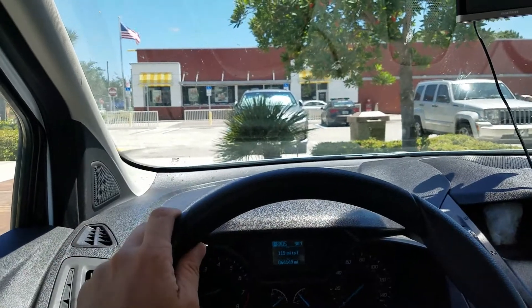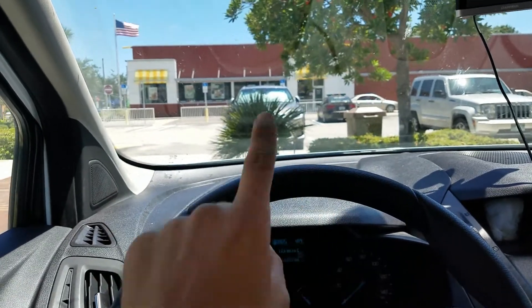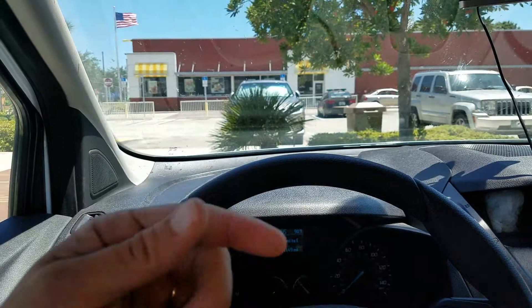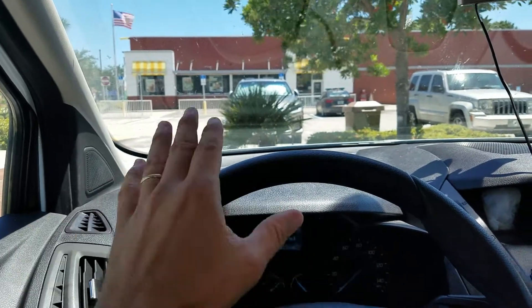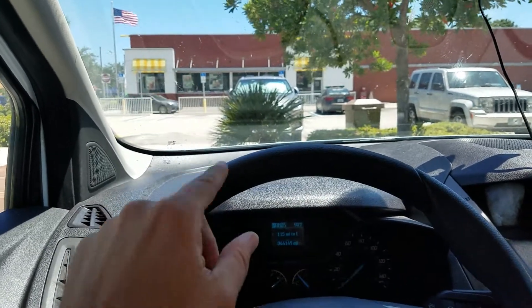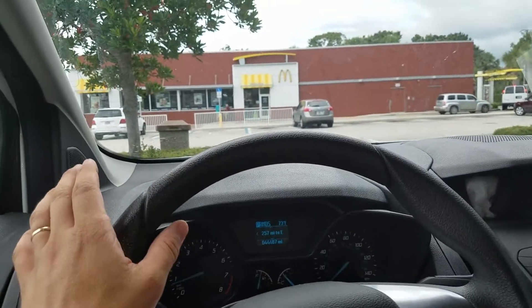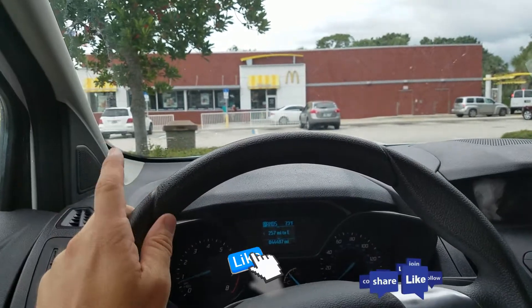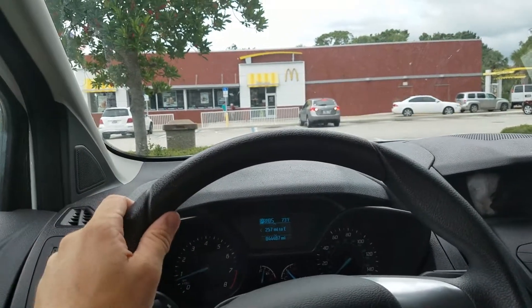I showed you the amp draw — we're getting proper amp draws, and comparing to the other vat that was working fine confirmed they matched. More than likely it had too much oil causing slow recovery, or the plug wasn't fully seated. I reset the faults and showed you how to do that. For the E10 high limits, I lifted the element, cleaned the high limit probe, and the error didn't happen anymore. If this helped you out, hit that like button, leave comments or suggestions below, and subscribe and hit the bell for more training videos. See you later!